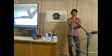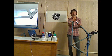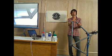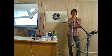Cool. Is that something you only do at a shop? No. Frame builders rarely will do that kind of prep, and it's important with a steel frame like that to include internal protection, especially in this climate. It's really, really important. That thing is a multi-thousand-dollar investment, right? And if you don't prep the inside of it, it could deteriorate from the inside out.